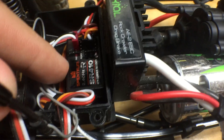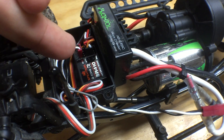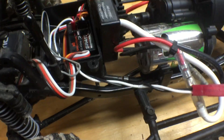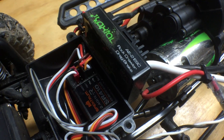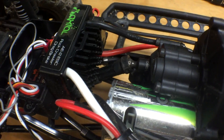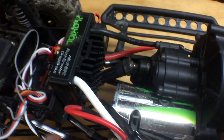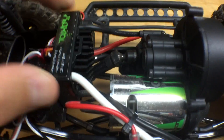I've got my Spektrum receiver in here. I've got ten extensions ordered — I'll use four or five, however many are needed — then I'll Plasti-Dip that as well, so both will be waterproofed. I'm gonna keep this Axial AE2 ESC. I could get the HobbyWing 1060 QuickRun like I have for the other build, but the drag brake doesn't give me a lot of options and it's only 21 bucks. For now I've got this, so I'll just get a 10-cent balloon, wrap this in it, and stick it back on.